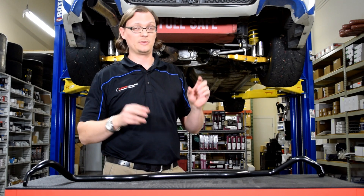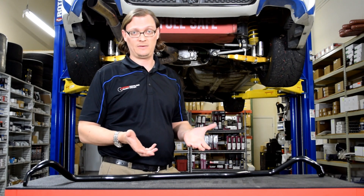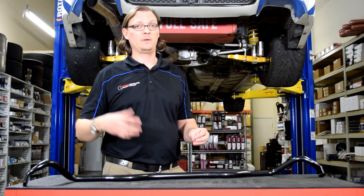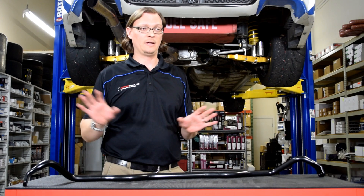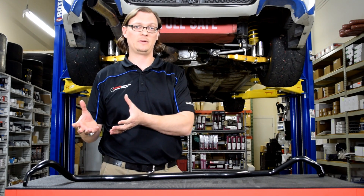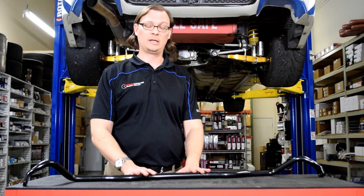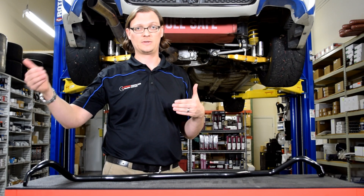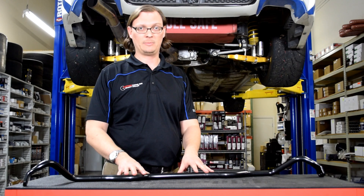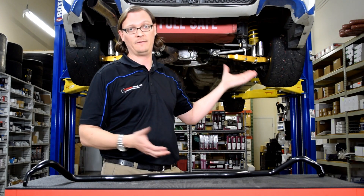As a quick footnote: when looking at sway bars, there's tubular (hollow) and solid sway bars. We prefer tubular because of weight savings — it's much lighter than a solid steel bar. However, you have to go with a larger diameter to get the same stiffness as a solid bar. A rough comparison: a 25mm hollow bar is about the same rigidity as a 22mm solid bar, give or take. Most manufacturers will give you a percentage increase over stock so you can compare. The only real limitation with a tubular bar is that because it needs to be larger, you can run into spatial constraints for how thick a bar you can fit in a given location.